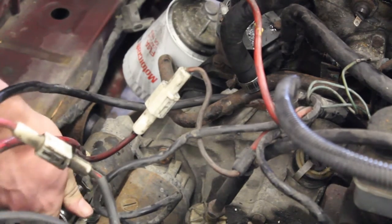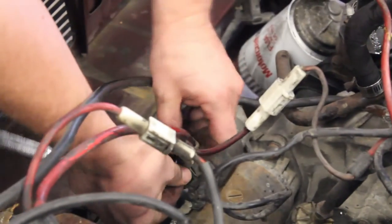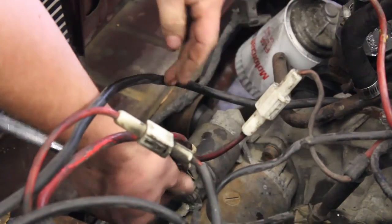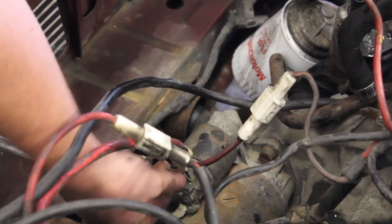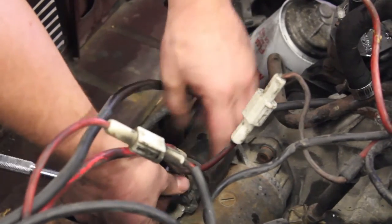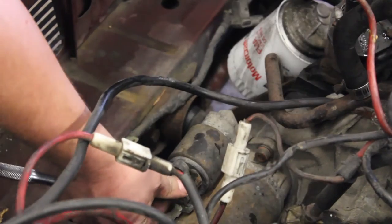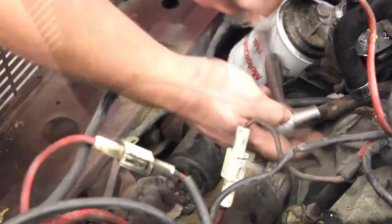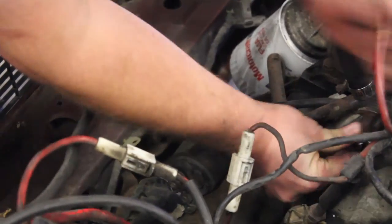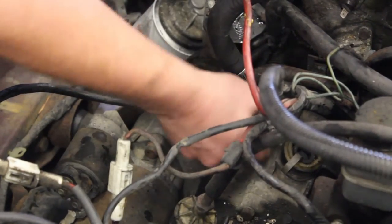After the cooling system is completely disconnected, we are going to disconnect the last of the electrical system. That is a 13 millimeter on the starter bolt here, which will remove this cable. Unplugging the starter wire that actually goes to the switch. And then we will get the ground wire here. Make sure that you put your bolts back on because we don't want to lose those, or put your nuts back on. And now the ground that goes to the motor. Same process here.